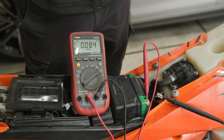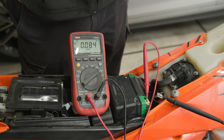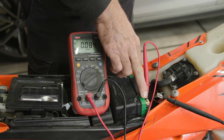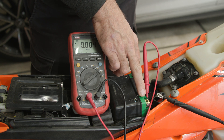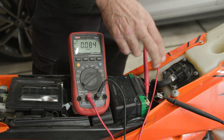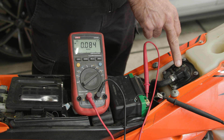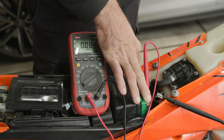Some people like to use battery tenders, but for a lithium battery because the self-discharge is so low it shouldn't really be necessary. If you do want to use a tender, I would recommend disconnecting it and connecting the tender directly to the battery. One issue you can run into with fuel injection bikes which have a fuel pump is if you leave it connected and connect a tender, it can cycle the fuel pump. You'll easily be able to hear whether that's an issue or not, but an easy workaround is to just disconnect your battery and connect your tender if you want to.